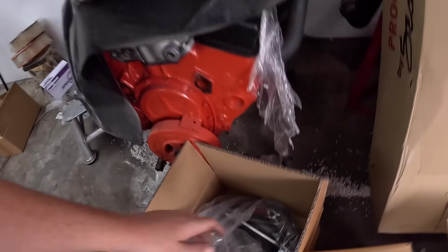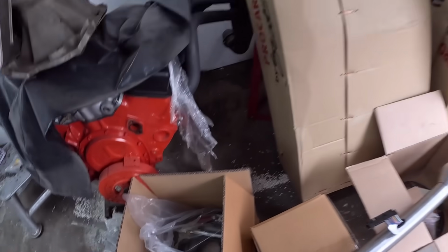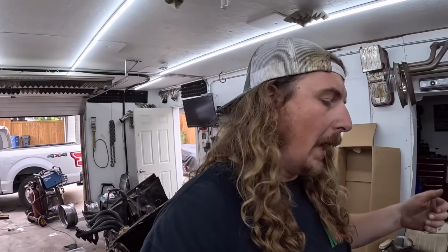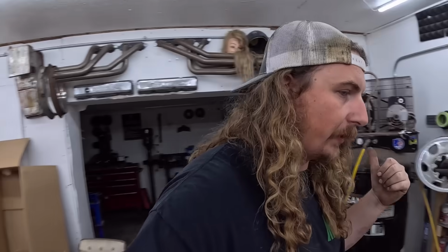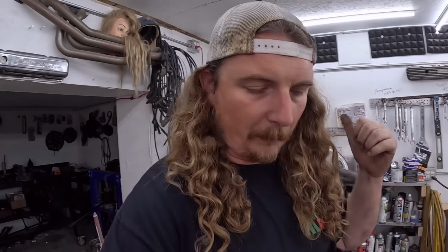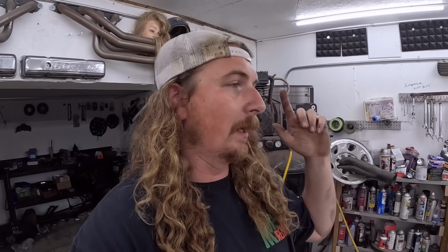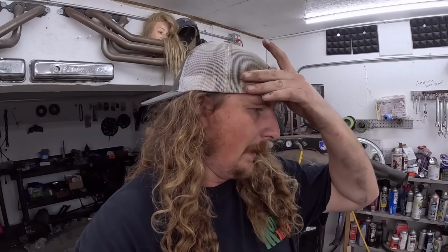And brakes, drums, the whole deal in each one of these boxes. So I did a bunch of stuff. I rebuilt the 10 bolt Chevy out of a 70 Nova or something like that for a 56 Chevy. By the time you go through it, put a posi in it, went through bearings, and needed one axle, and all these little bits and bobs, it was like $1,200.